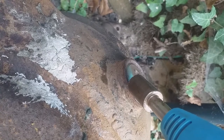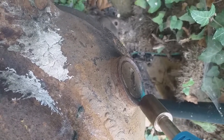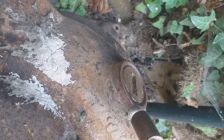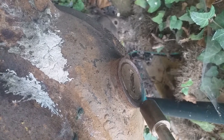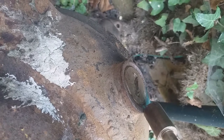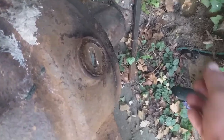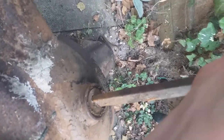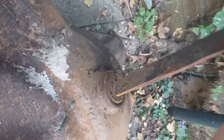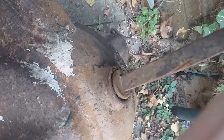You can see it's starting to perspire - once it starts to perspire you know you've heated it up enough, well at least at the top. It's starting to perspire now. Obviously when you get close to it it's going to be hot, you don't touch it. So that was a battle, which we won. There we go - plenty of crap coming out with that. Wow, I can smell it - it's not roses either, it's old EP80.